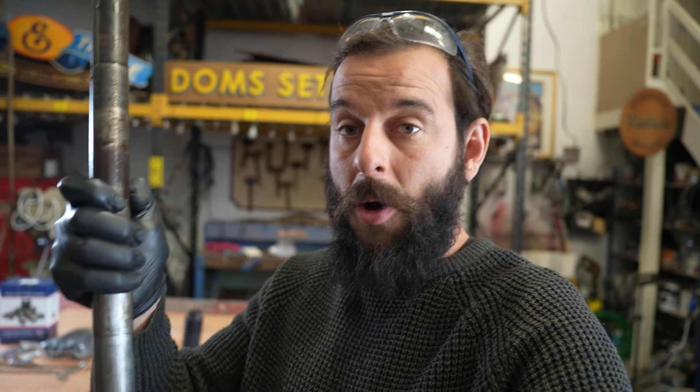These were painted silver and I was staring at it thinking why is it so shiny - I thought they were cast aluminium. John steered me right: it's a cast alloy bottom bit, the rest is steel that's been chromed, and the previous owner had painted it silver. You can't paint over chrome - it doesn't matter what primer you use, if you sand it or use etch primer, it's going to peel straight off. As soon as the degreaser touched it, all that metallic silver paint just came off. I've buffed up the original chrome underneath. There are areas where it's worn but that fits with the look of the bike.